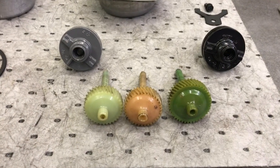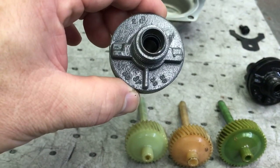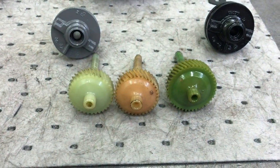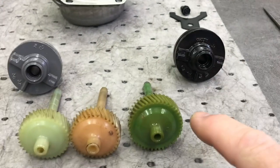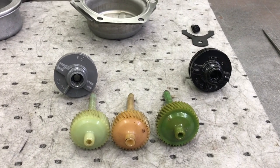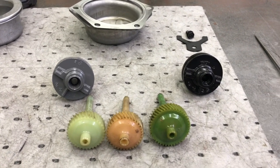For the speedometer driven gear, the number of teeth on the gear has to match the numbers on the housing that holds it. For instance, this is a 36-to-39-tooth housing — it has to do with the offset, and they come in different heights, so that wouldn't fit in that. But this is a 43-tooth housing and that's a 43-tooth gear. I just want something that will potentially drive a pulse generator — I'm not trying to make the mechanical speedometer accurate, just something that spins with the output shaft.